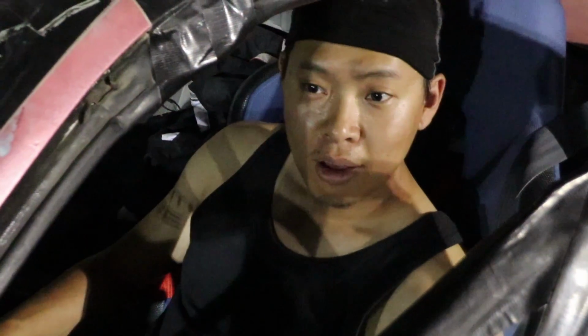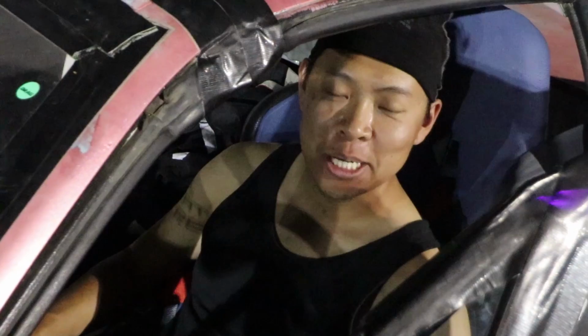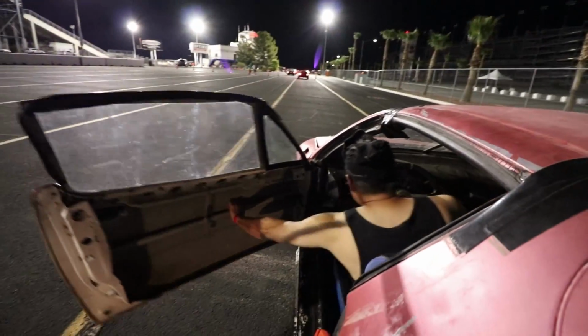How you feeling, Mike? I feel good. My goal is to at least get a 12.5. Feel the car out, but it might run super rich on the top end, but we got a data log to see. But rich is better than lean. I'm sure tightening the alternator belt helped with the voltage. Right. So, yeah, hopefully we'll see what happens. And hopefully don't embarrass myself. You'll be fine, just get it in gear.